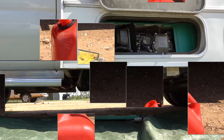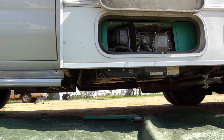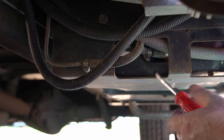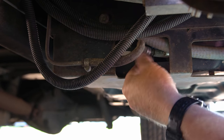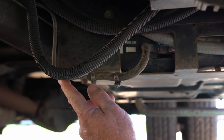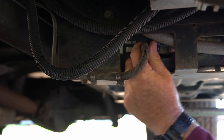Now step two: the next step is to bypass the fuel line from the vehicle tank so that we can hook in the separate little tank of gas we prepared. To do that, we've got to go underneath. What we're going to do is come up in here and undo this little hose clamp, loosen it a little bit, move it back on the hose. So now we've got the hose clamp pulled off and we're ready to pull the hose off. But this is a straight line to the fuel tank, which is actually at a higher elevation, so gas is going to flow out of it.